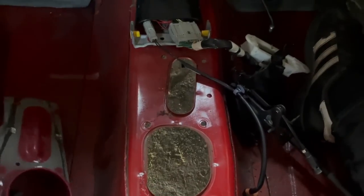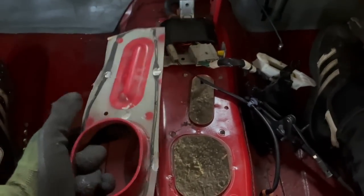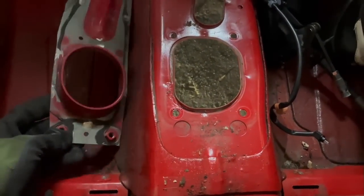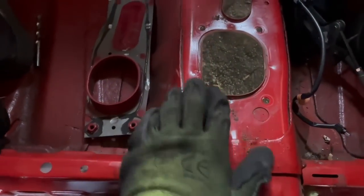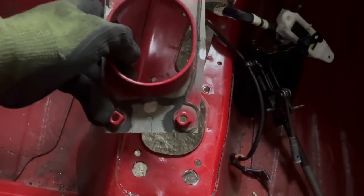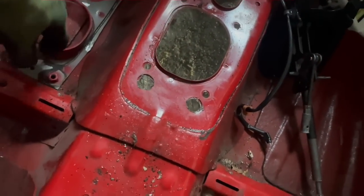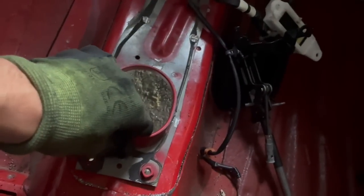That's what we're left with then in the interior, and this is our automatic to manual shifter plate that we drilled the spot welds out of from the other car. And this comes right in here from the end and under. So as you can see here, I need to drill out these two holes so I can get these nuts through. So let's do that first. Boom! The holes are now drilled out. Should be enough space for these little nut thingies to come up through. So yeah, let's now get this in place underneath the car, and then we should be able to weld her in.